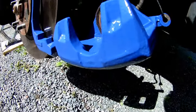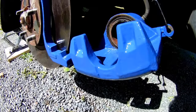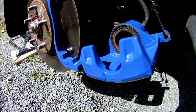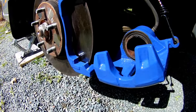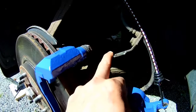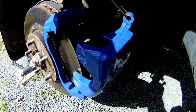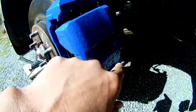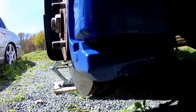This is something I haven't seen in another video: hinging the caliper. To me, it's just so much easier to have full access to the inside of the caliper, the piston housing, and the underneath backside as well. What you want to do is disconnect the brake line from the spindle, put a bungee cord, and it hinges from the bottom guide pin, giving you full open access to the entire caliper and the piston housing all the way behind it.